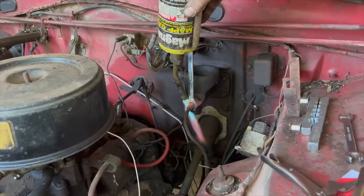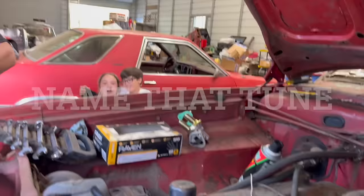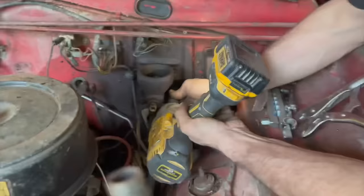Come on. It's wanting to twist off, so we're probably gonna put some heat to it and put the vise grips on it. I hope this works. I hate making new lines on these rusty old cars. Broke right off. Awesome. Well, looks like we're at least putting a new end on this one. This actually has a bolt that holds the master cylinder in instead of a pin like normal. It's weird to have one with four bolts. Usually they just have the two, you know?